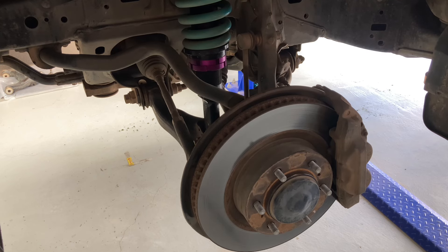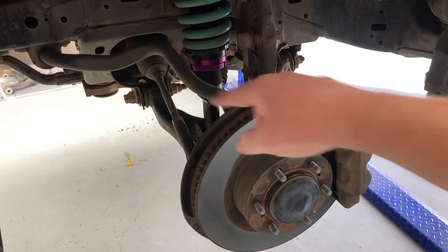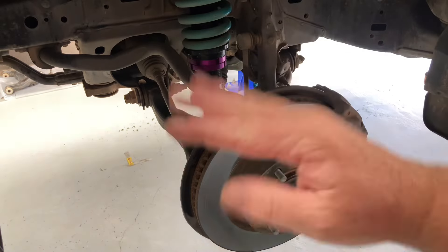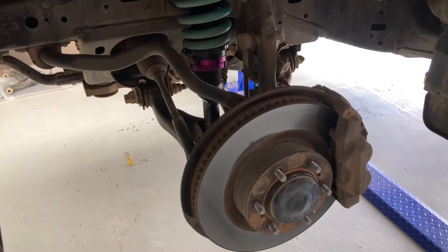Subscribe and turn the bell to get the whole picture. These bushes in the lower control arms — the lower ones — they're totally, absolutely flogged. The vehicle was on original suspension for 200,000km, part of the problem being bouncing over speed humps and twisting the bushes. Then the Dobinson's twin tubes went in, got hammered in the outback for 100,000km, probably stayed in there a bit too long — less control in the front, more bouncing over speed humps, braking and all that, twisting these bushes. Twist them less is better.